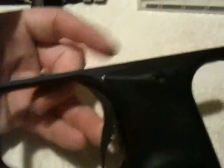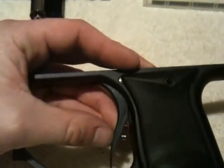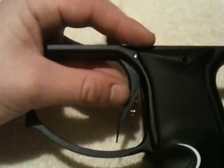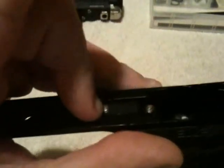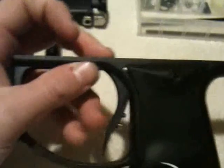Just a word of thought. With the trigger, with the body on, you really only see two adjustments which is your magnetic return — what the manual calls your rear — and then the other one right up here where my thumb is, is your forward. Of course, you also have the micro switch activation right there. What we're going to do today is go over some measurements on each of these to make this trigger smooth and be able to rip paint through this marker without a problem.